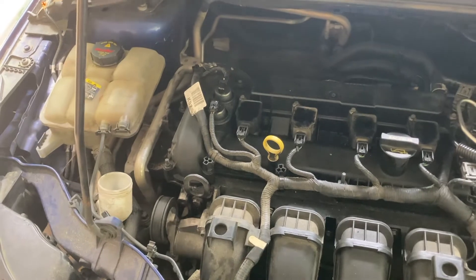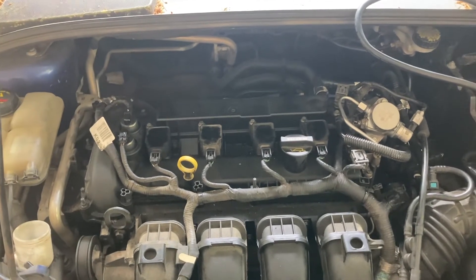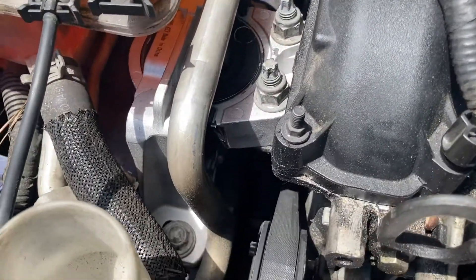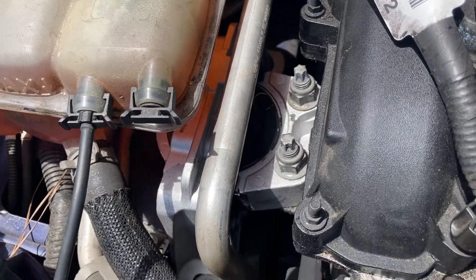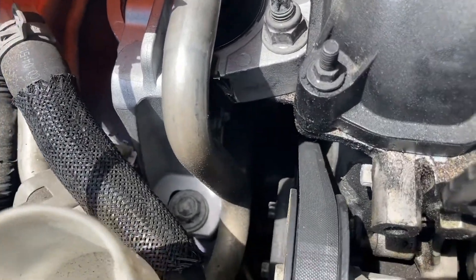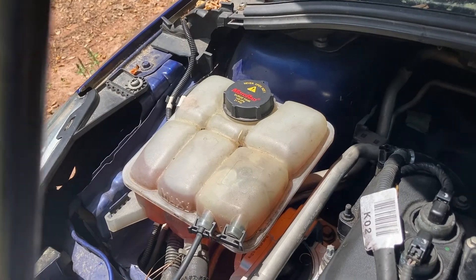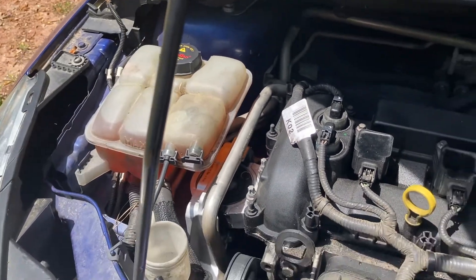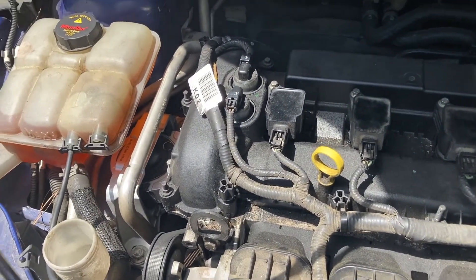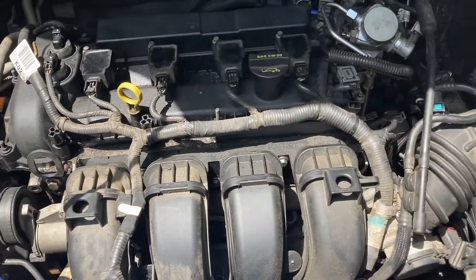These mounts are not very expensive. If you go OE they'll cost more but last longer. We did get this engine mount put on — only four bolts: two on the engine and one on each side of the car. All I had to do was remove the coolant bottle. Getting that on definitely took out all the hum that was in the driveline. It purrs smooth as a kitten now — no hum, no vibration.